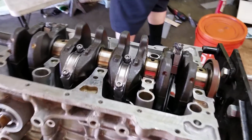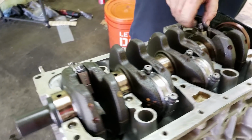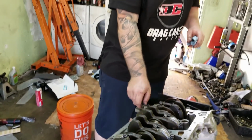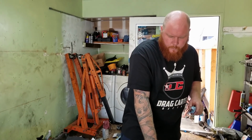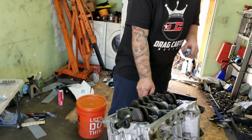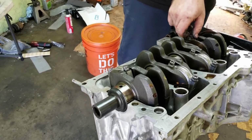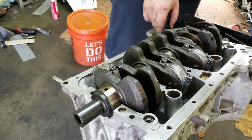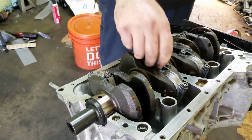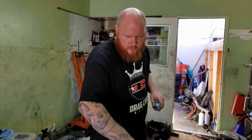Ooh, nasty. Those are our pretty bolts. Yeah, most companies use ARP. It's a good manufacturer. They make good bolts. So, Pauter told me I need to torque these to 50 foot-pounds. So I'm going to do 2 steps. I'll probably do like 20 and then 50.